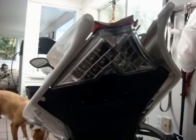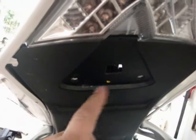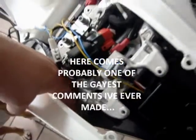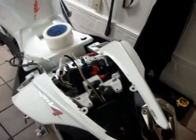So here is the new tail light with all the integrated stuff, and if you see here, there's two screws here, one here, pulls off the old mechanism, and then here you've got where the wires were coming through to that old light. You see right here, this clip actually has to go inside of this little piece right here, and it is such a pain to get out of the last light. Make sure you don't break that. If you do, you're hosed.